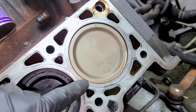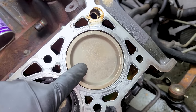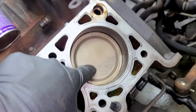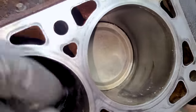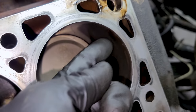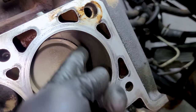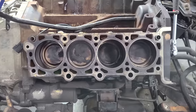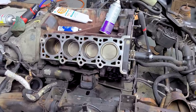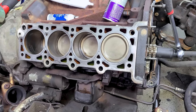After a few minutes and a couple of scrub downs with the toothbrush — look at that, so pretty, so clean. You'll have a little bit of wax residue on the cylinder, that's not going to damage anything. The only place it has to go now is down. As you can see it is almost perfectly clean in there — just a little bit of a wax ring and a little grease left over. Perfectly smooth — we didn't grind anything into the piston rings which would have chewed up the cylinder wall. So we went from dirty deck surface and carboned-up pistons all the way to this.